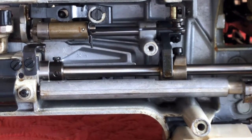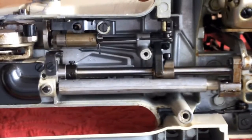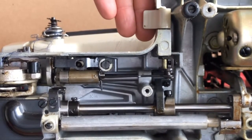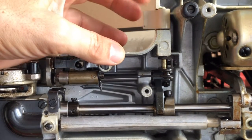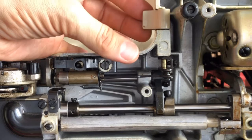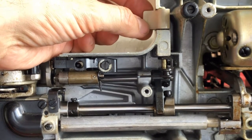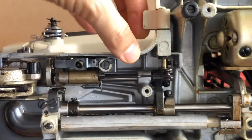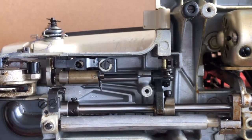This is a huge surprise — this machine has, like many machines, a feed dog lowering mechanism. When I turned it, I was very slow and careful — I was expecting this not to turn at all. You can see my finger pushing on this little lever — it's attached to steel. Look below at the metal rod that this plastic is attached to. Never force this — these are often frozen because they weren't used. But I was surprised it moves. If you look at this little piece, it looks like a little torpedo here, it's actually going. Strangely, that is okay, and that's a good thing.